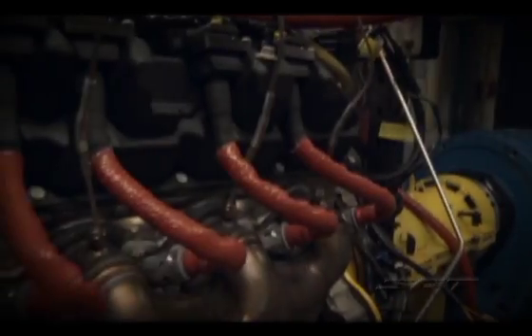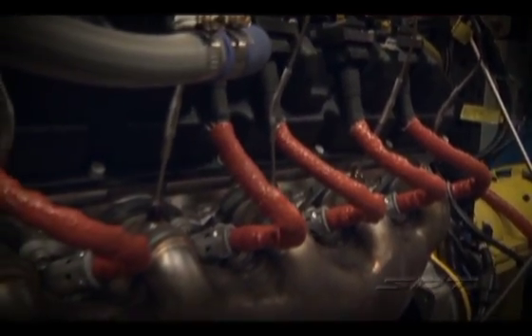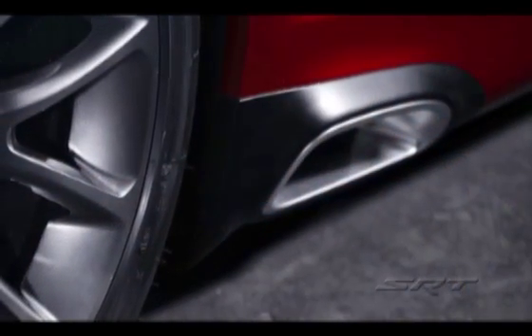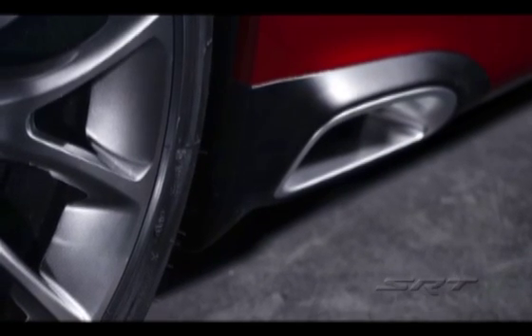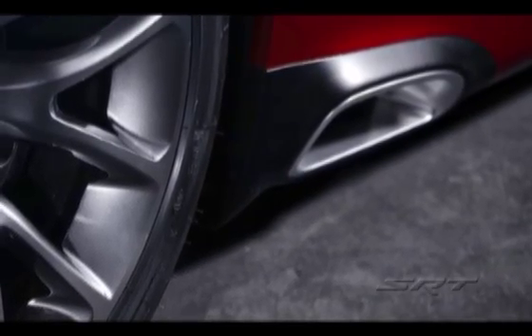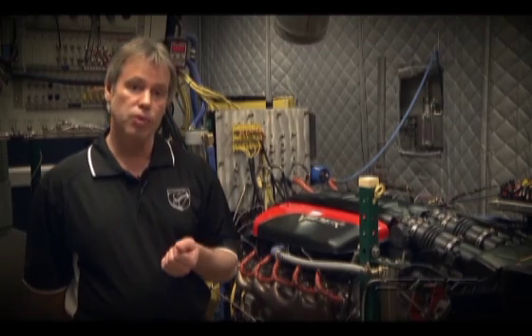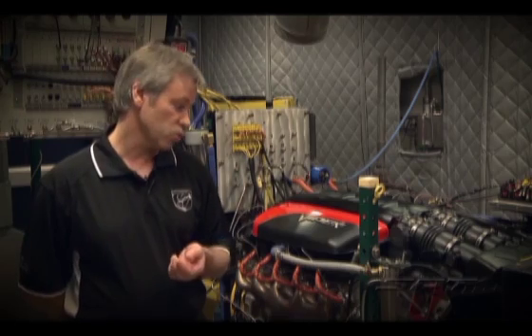This part being a tube and shell-type manifold does a really great job of not only keeping heat out of the car — much better than in the past — but it keeps the heat in to heat up the catalyst. Changing the wash coat process, we were able to go to a single-pass wash coat instead of a two-pass, and it allowed us to reduce the back pressure through the catalyst by about three inches. That was worth six or seven horsepower by itself.